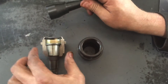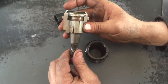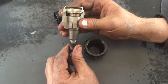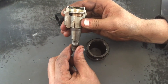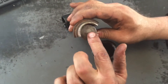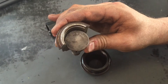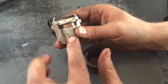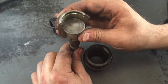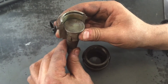The cause for alarm is because of the normal style of ball joint, which is this — a factory or Moog joint. This is the actual construction of it. You can see how this one moves back and forth, so I understand the fear of a loose pin and death wobble. But as you can see from the top, there's quite a bit of room and this head isn't supported by this chamber. The only thing supporting it is the bushing around the pin. When you hit a bump really hard it'll bang it back and forth and loosen the little babbit bushing in here — that's where you get your play.